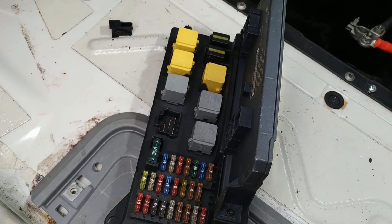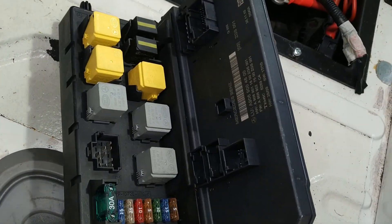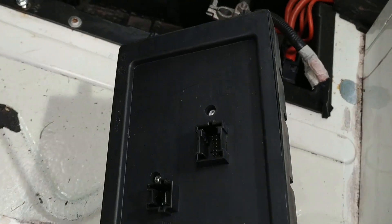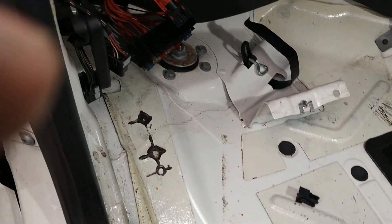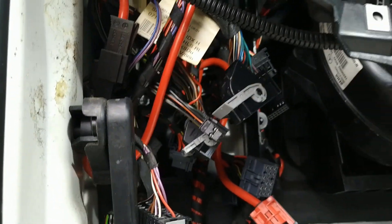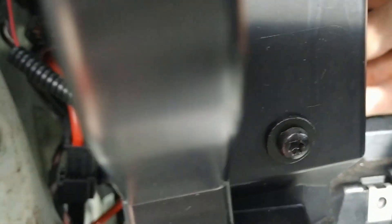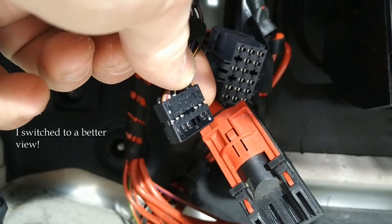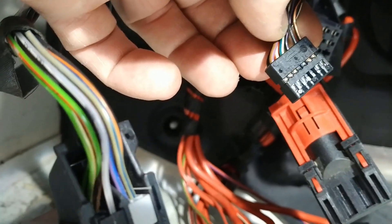The wiring diagram says it is on pin 12 of connector H3, and connector H3 isn't on the front — it's on the back, right at the very top. The wiring diagram calls these all sorts of things depending on what you're looking at. It's H3 on here and there's a real hornet's nest of wires. The connector I'm interested in is that one there — that's H3 minus the shroud. The blue and white wire is just there by my thumb and that goes to pin 12.